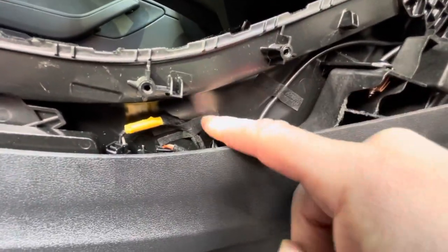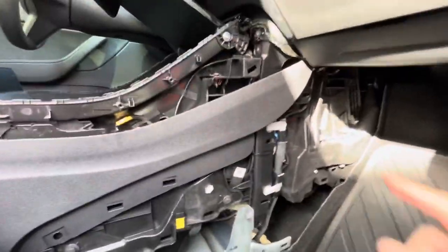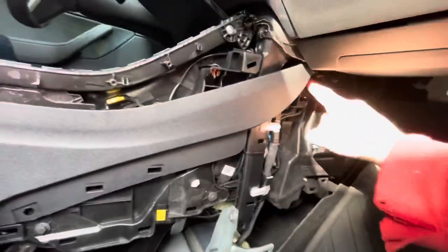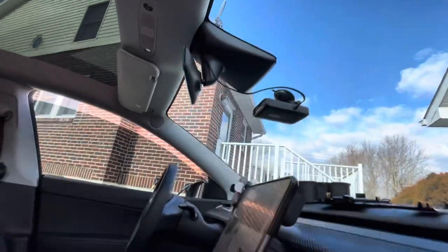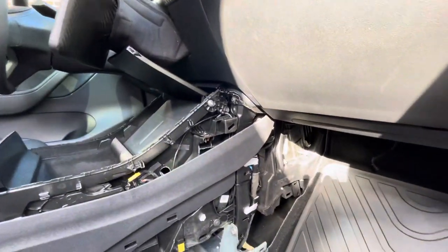I let the charging pad drop down, made sure I was going to clear it, used a hole saw, and drilled right through to run my wires. I taped the wires inside to keep them away from any moving parts, hinges, and such. Then zip ties here and here to keep everything away from moving parts and keep it neat and factory-looking. When I sell the car I'll leave the hardwire in for the radar — it was 18 bucks on Amazon.